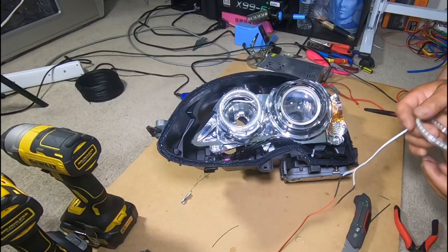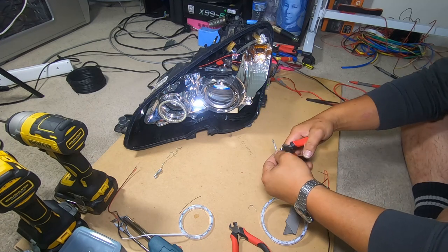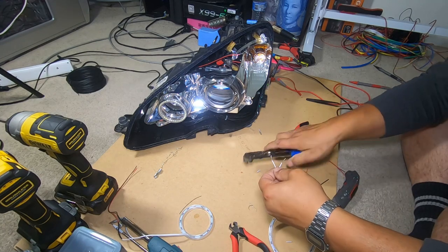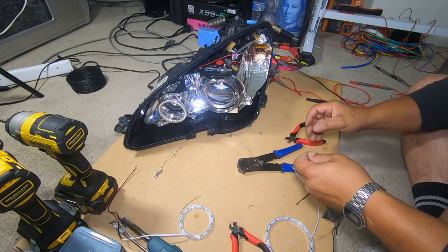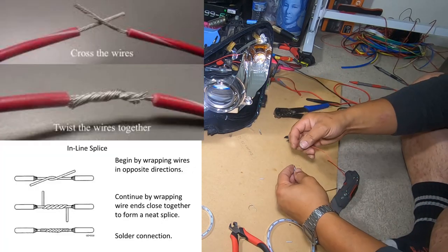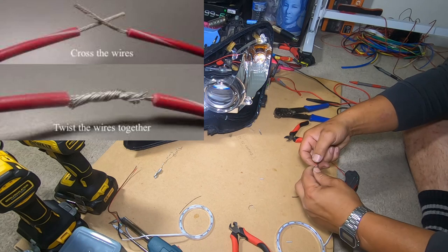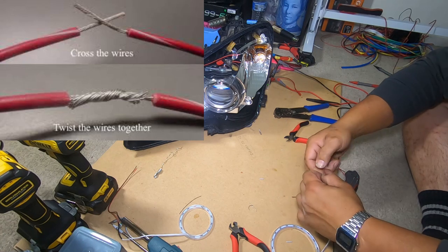Now you get the idea of how to do your low beams — it's basically the same principle. Depending on whether you need a little bit more cable, you just solder on a little bit more. For those of you who've never soldered before, it really isn't that hard — soldering is something you just keep practicing. Strip enough wire so that you can wrap it together and twist the wires so they don't spiral out. The point is to heat up the wire, not the solder — heat up the wire so that you can add the solder to it. Allow it to heat up and when it melts, spread it along your wire. Cover it with your heat shrink and apply heat so the heat shrink shrinks. That's how you extend your cables.